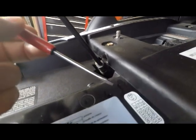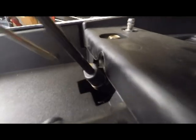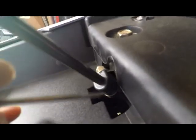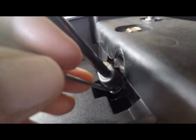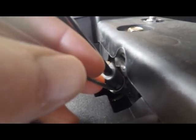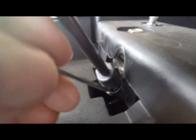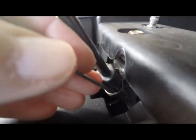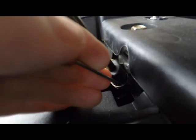What you need to do is get a small screwdriver like this — a real thin blade. Right down in here, this is on the bottom side where the gas shock connects to the bike. Just get this underneath the clip and it should just pop out.